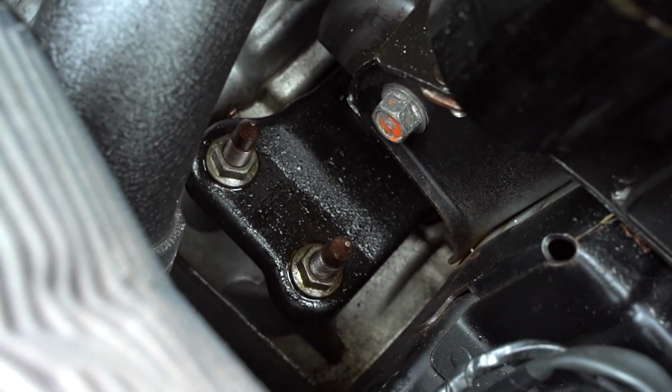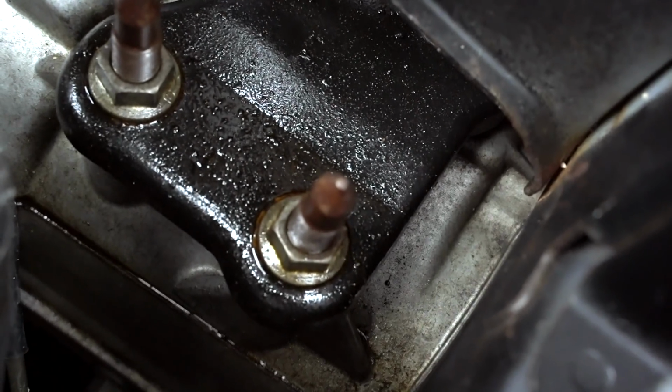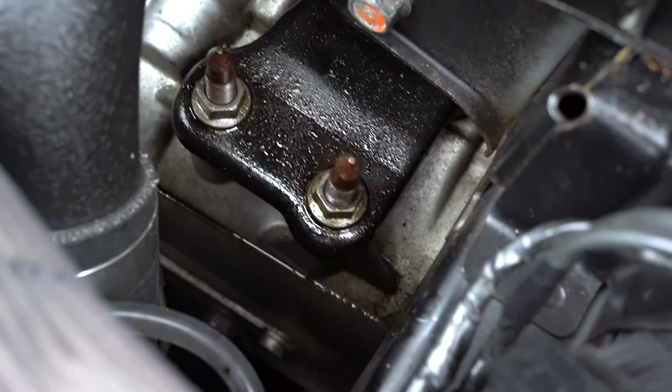So if you look down underneath that motor mount, you can see that there's quite a bit of space, but this is a 5-speed, the Blue 8's a 6-speed, so it might be a little bit different, but I'm fairly confident we can make that work. Let's just test the waters. I'm gonna mock up the AYC pump on all the brackets, get that whole thing sitting where it needs to be, get the headlight on there. I guess we could just set it on the fender and just see how much space there is. I know there's other people that have done it, so I don't know why we couldn't do it, but I wanna make sure for myself before I just start cutting apart the entire harness.